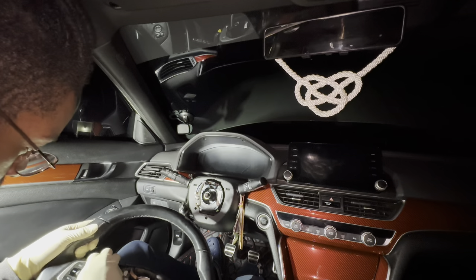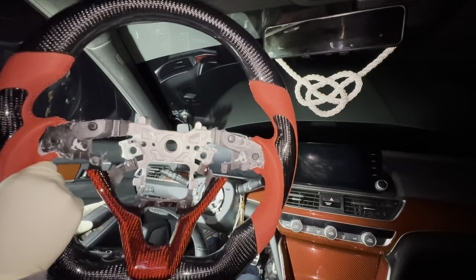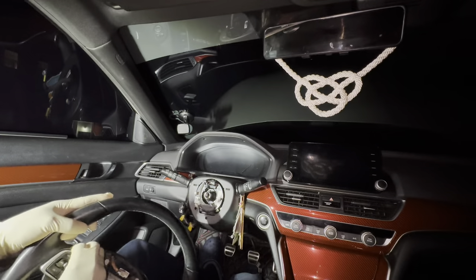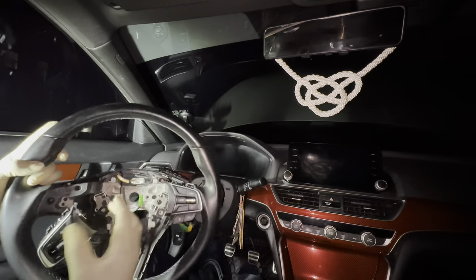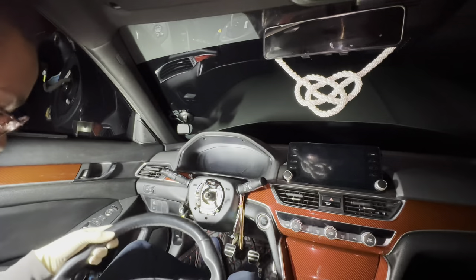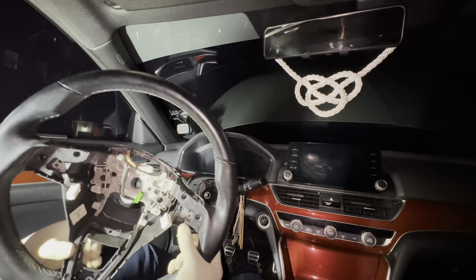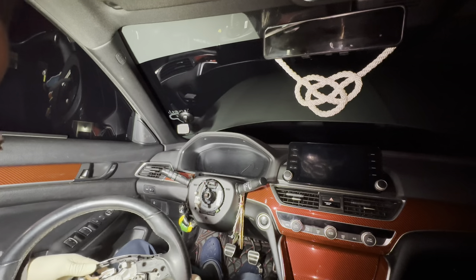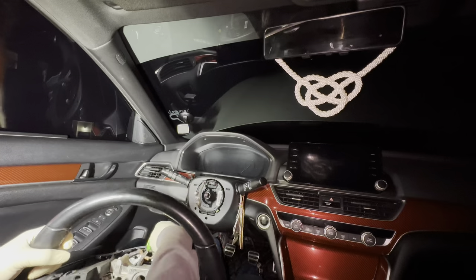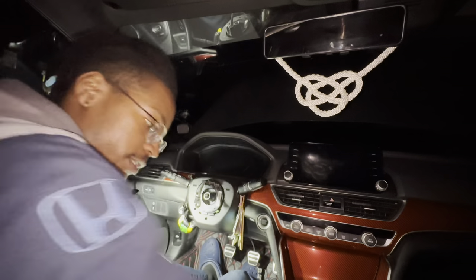These just pop in — there's these little holes right there, one and two. You're gonna have to wiggle it pretty good because that's how they're locked in. Then just unplug the connector and put it to the side. Do the same on the other side, just wiggle it out. This just pops off now, just like that. Boom — old skeleton, put that in the back.